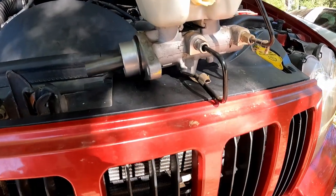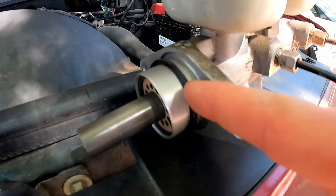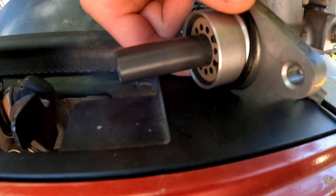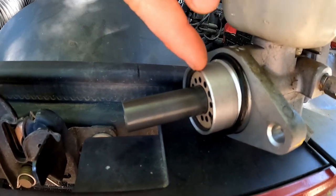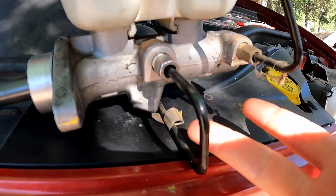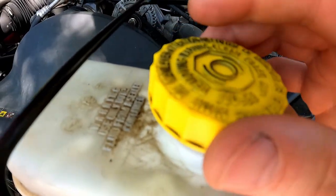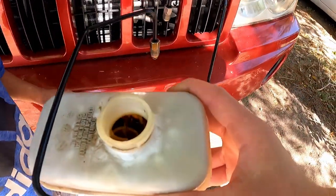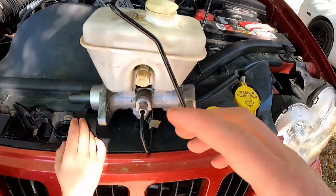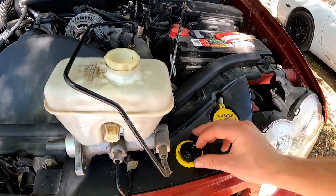Now I got a little helper Cohen here. What we're looking at — you can see right here there's a little buildup on that ring, but the ring looks like it's intact. Inside there it could just be failing on the inside, because there's nothing leaking from either of these two ports, which is a good sign. But when we remove this cap and look inside, you can see all that nasty buildup. So we're going to have to go ahead and replace this, because that means there are a lot of contaminants in there and the master cylinder has more than likely failed.